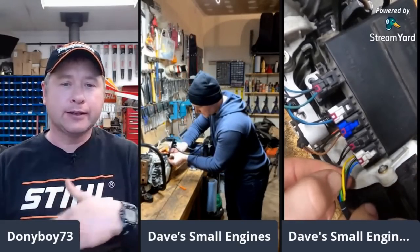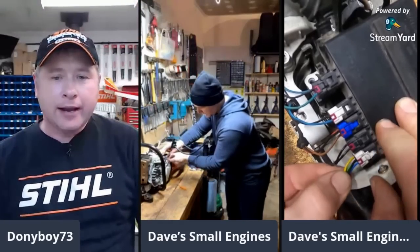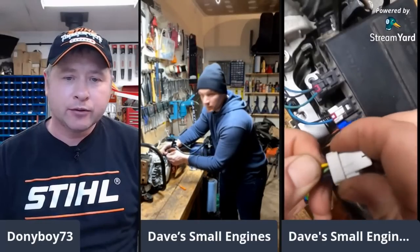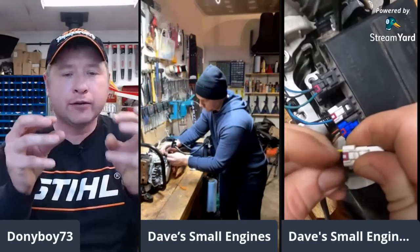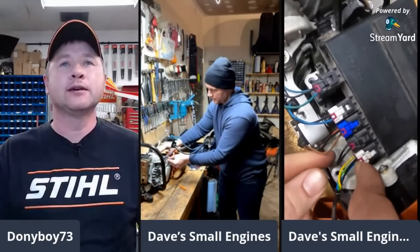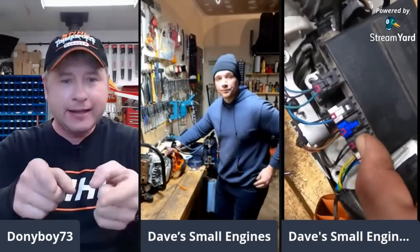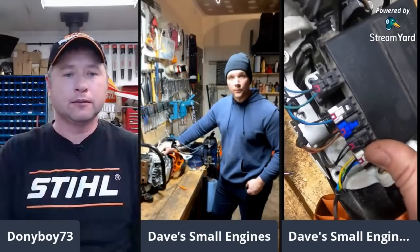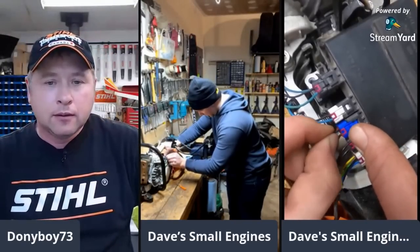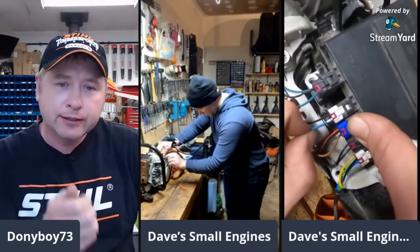And you said you already took them off and cleaned in there, so I'll take your word for that. I have, yeah. So that pops out obviously, but yeah — it's okay if you've got it popped out. So what you want to do is just in a small pulling motion with very little force, you just pull on the wire. Because here's the kicker — what I've come across is some of these wires, when I did that test I'm asking you to do, the wire just poof came out. So you need to check all four plugs here. The first three — they're all sitting as they should inside the connector, right? It looks pretty good. And make sure it's pushed in all the way.